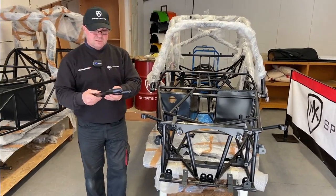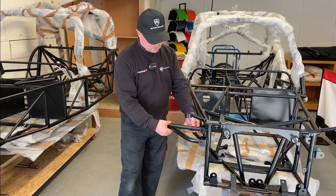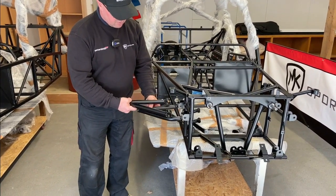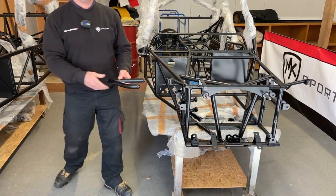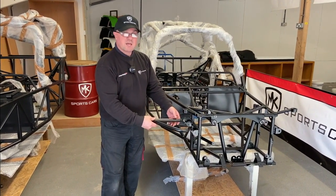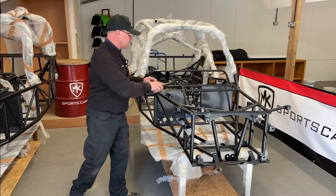We also have rose joints here — rose joints that screw in and screw out, which fit into the top section. You can see they're very different if you put the two together in terms of where they fit and their size. If you're looking for adjustment and track day use, this is fully rose jointed so you can adjust and shim according to caster, camber, and toe of the vehicle — quite a big difference in terms of adjustability.